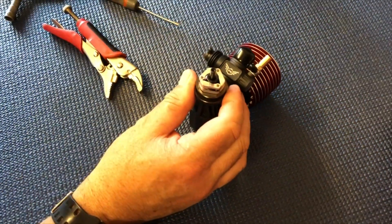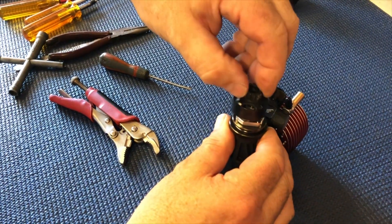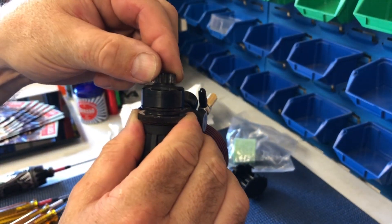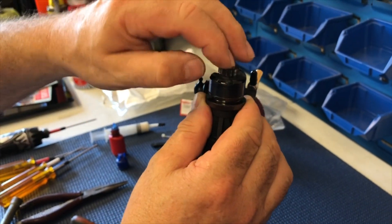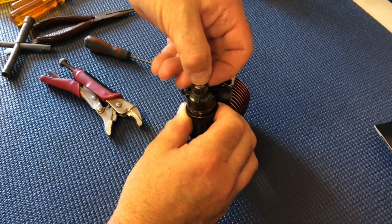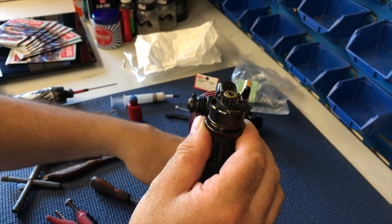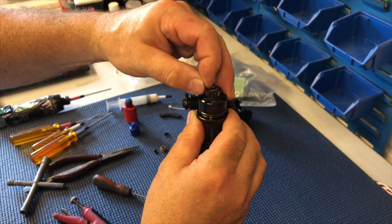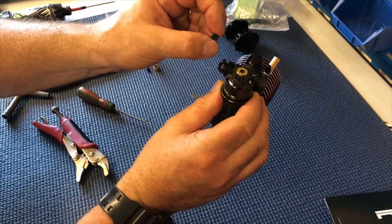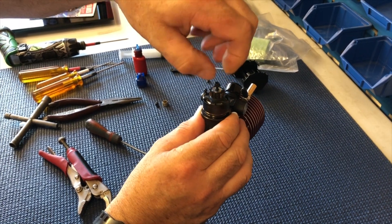What I do then is use two of the shims that come in the kit to go on top. Place the bearing on and just make sure that spins freely — you can see a nice gap there, that's what you want. A little bit of daylight; you don't want that rocking. With only one bearing you see some movement, but as soon as I put the two bearings on there's no rocking at all and you can see a nice clearance. You don't want this hitting your clutch bell. Then I get another shim — maybe one or two shims — check if it looks a bit tight, then go for the thicker shim.